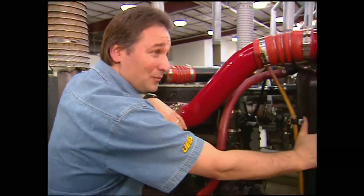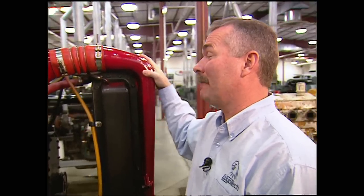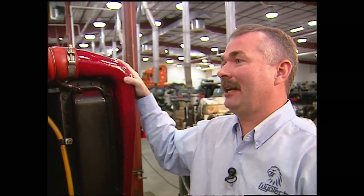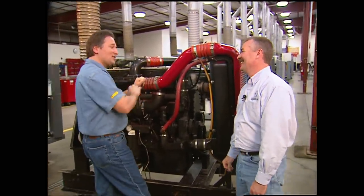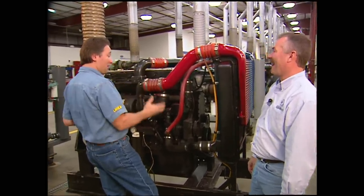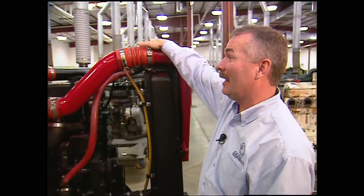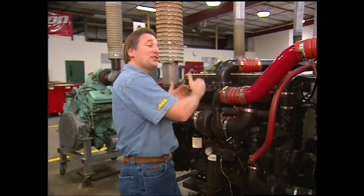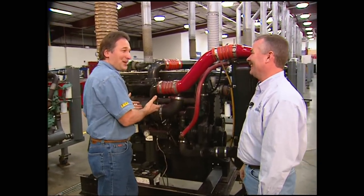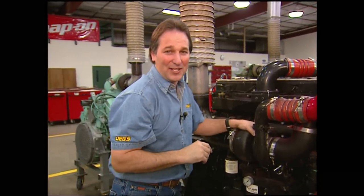Now, normal cooling systems use water to cool — this uses air. Why, and is that better? This is much better because we're getting a lot more cooling out of it. In the old days we used water after-cooling, and we could only get it down to the temperature of the water, which might be 180 or 190 degrees. Now with the outside temperature being much less than that, we get a lot more cooling. After cooler's hanging in front, we've got the cooling system going. The guy is running down the road, not paying attention to his gauges, got his foot buried in it — what happens if he overheats it? On this particular one it's an electronically controlled engine. If the air gets too hot, the ECM is going to shut you down, derate the engine and cut your horsepower back so you don't hurt the engine. Then once it cools down, you get the power back. So, the engine's smarter than the driver. That gives you an idea how heat is pulled out of the intake charge so you get a nice, dense blast of air into your engine. That is how it works.